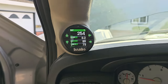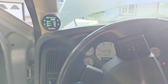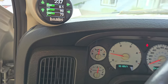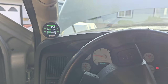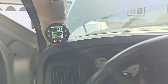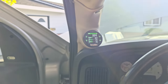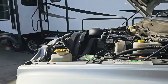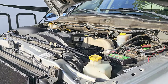The temperatures when cruising were probably 200 to 300 degrees lower. When going through higher load stuff — going through the gears as aggressively as this truck can handle — the peak EGT I had was about 1180. So really, really cooled off the truck — we're talking 220 degrees easily cooler than it used to be.